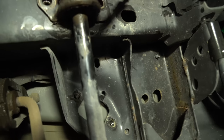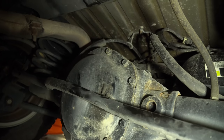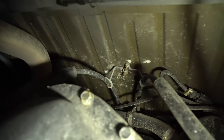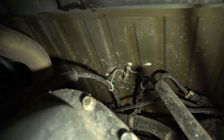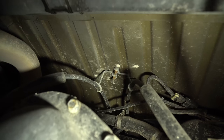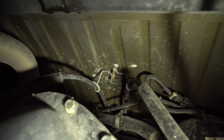Copy everything from this side to the other side. You'll see the diff right there. Look up at the top of the body — or the tub — and you'll see that wiring there. You want to loosen those two 10 mils and take those right off so they're nice and down, so that way when we're doing some stuff it isn't going to wreck them.